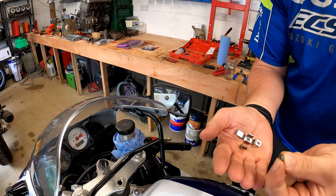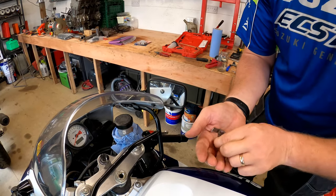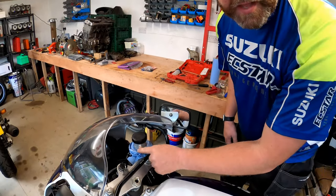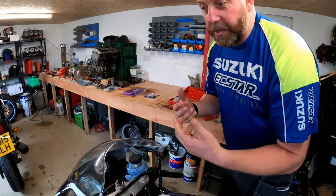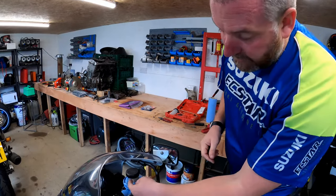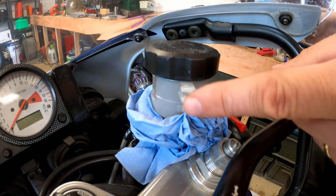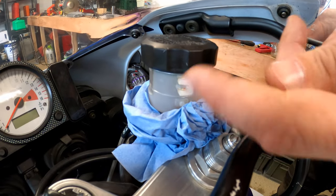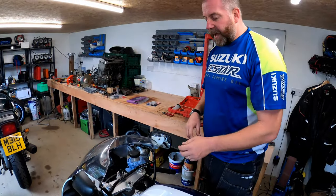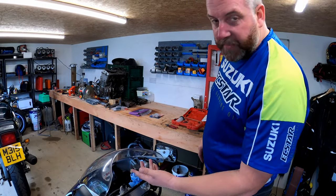This little clip sits on the reservoir cap and is held in place by a small screw and nut. Unfortunately these nuts like to turn inside the plastic moulding - the nut should be held captive but it doesn't take much for it to just rotate. I had to mess around to get it off, but it's easily recovered.